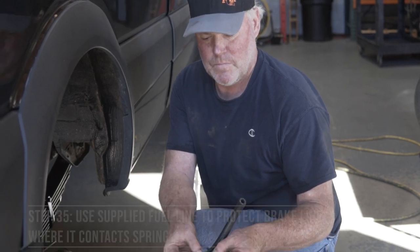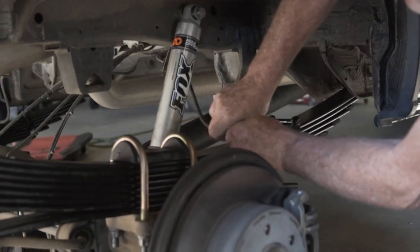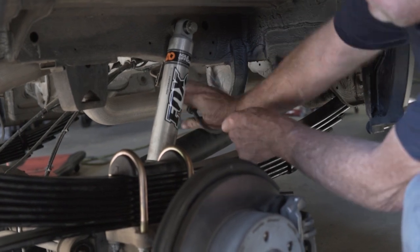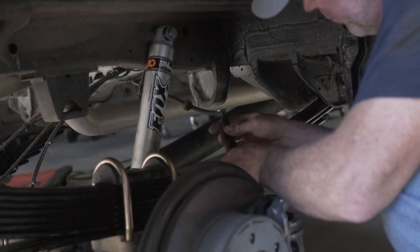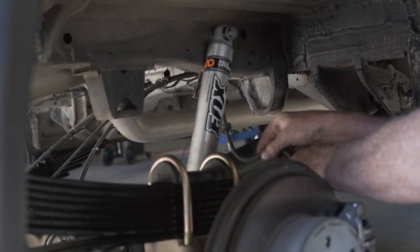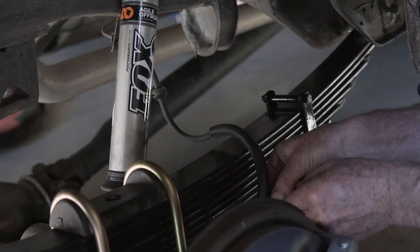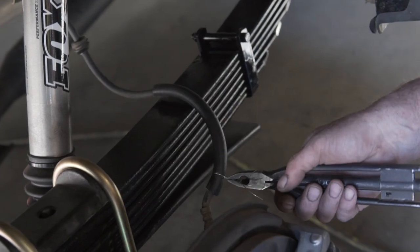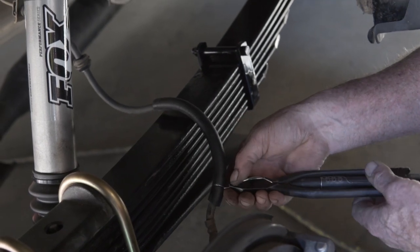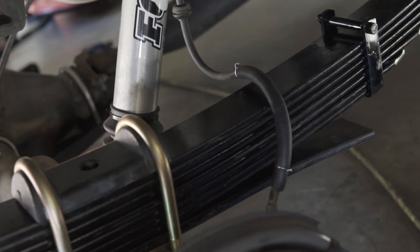Six inch piece, 3/8 fuel line. Slit it open. Take this rubber grommet here. It's easier if you lube it. Slide it up out of the way. Slip this over here. It's just protection for it, if it rubs. Like that. It's going to lay right there. Actually, you could use zip ties if you wanted to. You don't have to use safety wire, but you use safety wire. Oh, that's super cool. Boom.